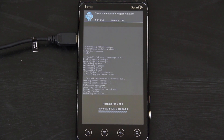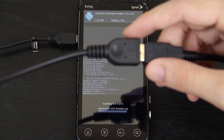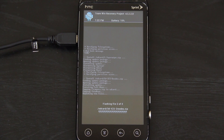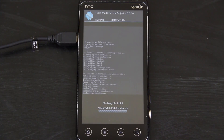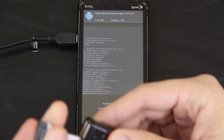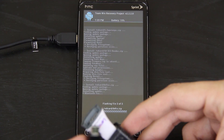MPGrim states there is a way to get USB OTG, which is the little adapter I'm using here — it's plugged into my phone and going to the USB port of my camera. You can hook up a mouse, keyboard, or flash drive with the Galaxy Nexus and other devices that support it like the Nexus 7. You can actually do an Android backup with TWRP Recovery and store that backup on your SD card so you're not using up your precious internal space. Or if you have a device with only internal memory, your TWRP backups will be on your external flash drive.